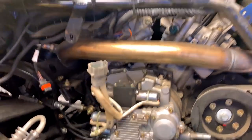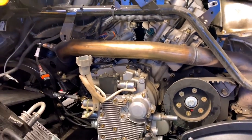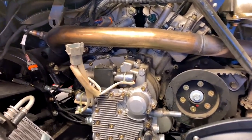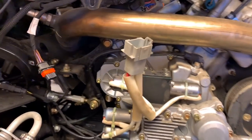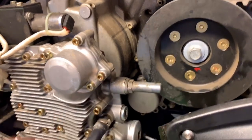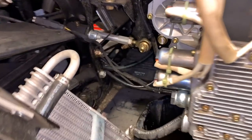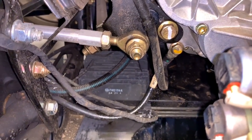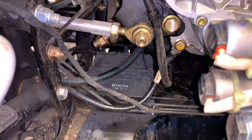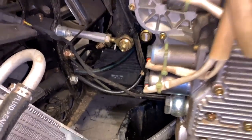Kind of clean, you know — typical Austrian motors, especially the older ones. The twins seem to be the last of these that have the trait of weeping oil. KTMs, Rotax — they always weep oil. But since the 1330s came out, all that stopped. It looks like I can get underneath here and get those out with the lower screws. See the finned item right there — that's a regulator rectifier. In a previous video I showed you how you've got to pull the paneling off the other side, but with this lateral support and all this stuff out of here, I can reach right through that hole.